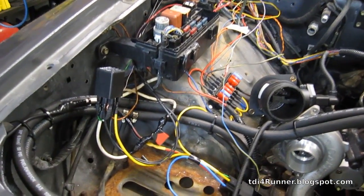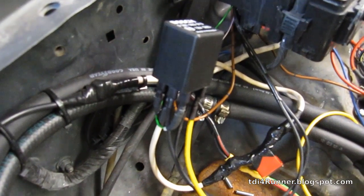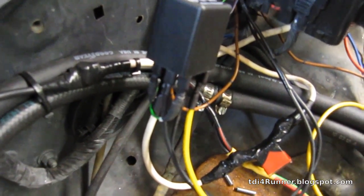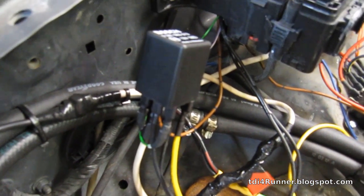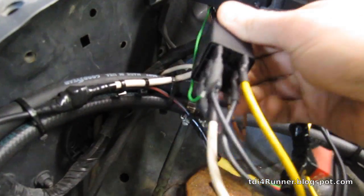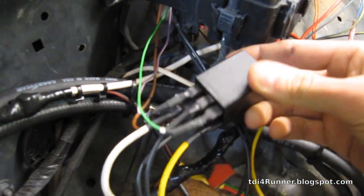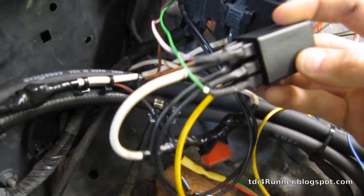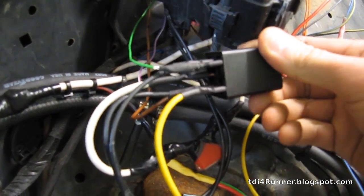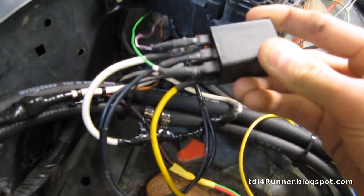I just finished wiring in the glow plug relay. I'm using the factory 7-pin Bosch relay for the glow plugs — it's actually more like a module in the way that it operates, but they call it a relay. It's got seven pins. This is the easy one; the later models have nine pins. This one just has two outputs to the glow plugs, while the later models have an individual power wire to each glow plug.